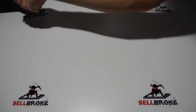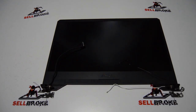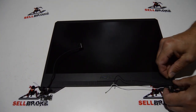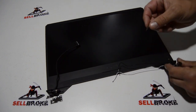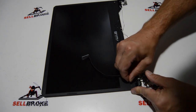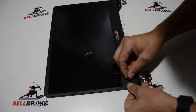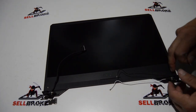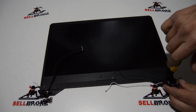Now we'll move on to the LCD. There are a couple of Phillips screws at the bottom with small screw covers. To keep the covers nice, use something really sharp — like a very small flat edge bit or the corner of a razor blade — to get in between the bezel and the screw cover. Once those screws are exposed, go ahead and remove them.